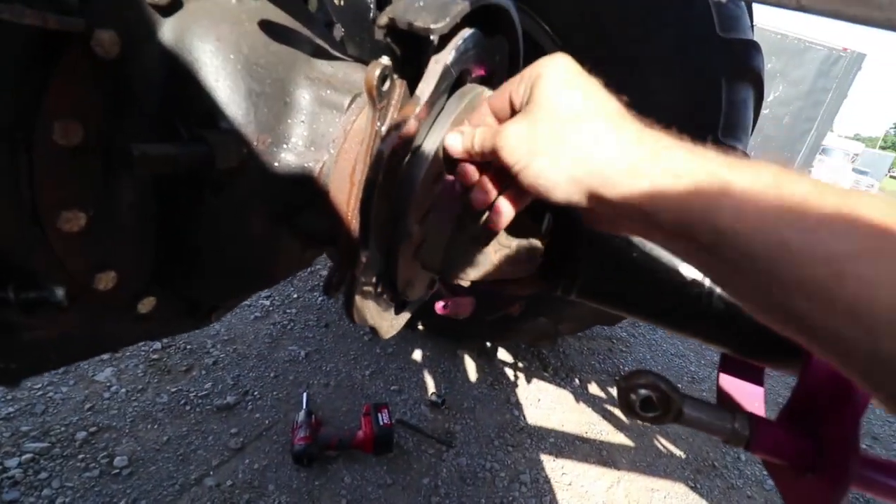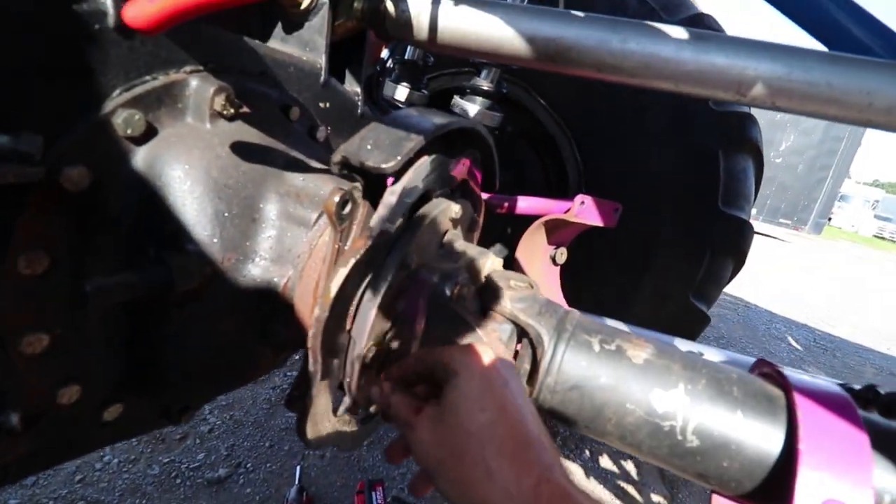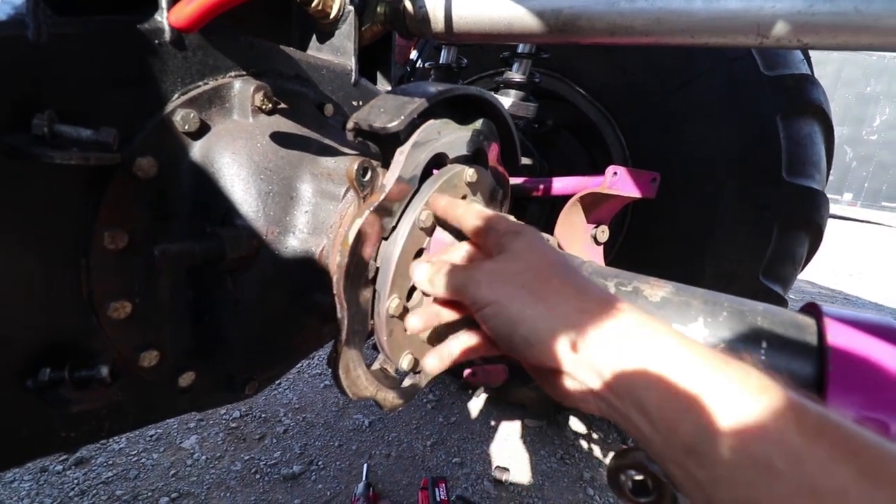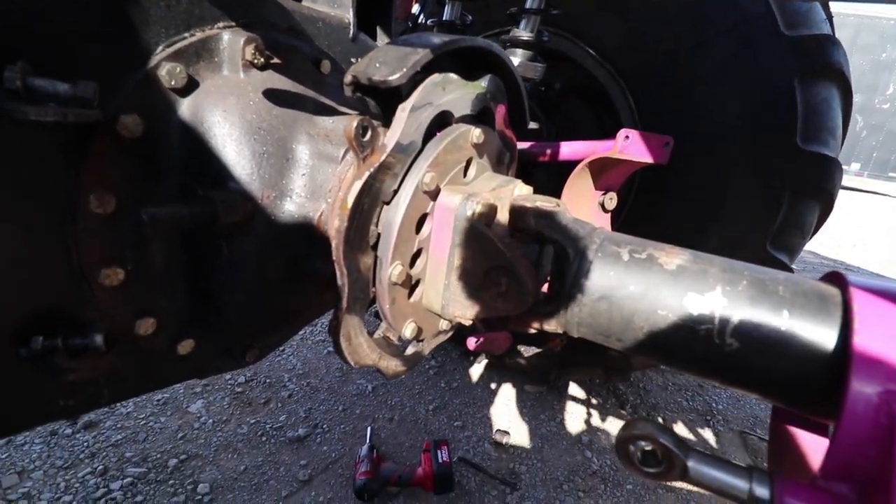While they're messing with that, I'm going to go around and tighten up these rotor bolts right here - go around them all and make sure they're all nice and tight. If you've ever experienced a dirt bike sprocket on the rear wheel, if one sprocket bolt loosens then they all start to - same principle.